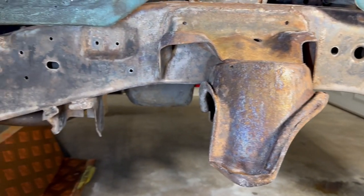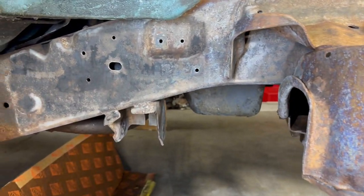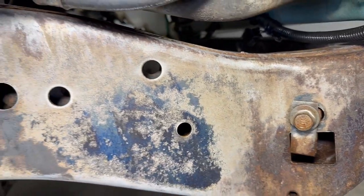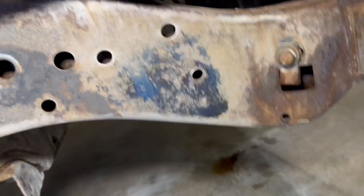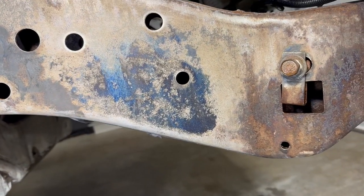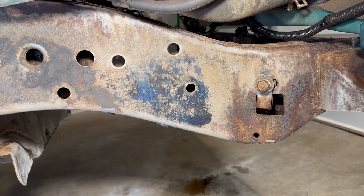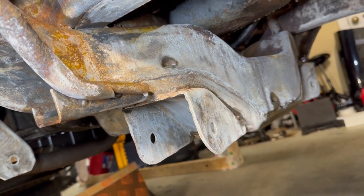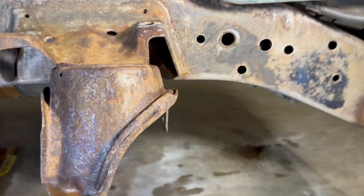Update: it's been about 3 or 4 hours and this section has dried out for the most part. I got a little nervous when it was still wet and hadn't changed color, but after it dried it's got this white powder to it, and on the areas that were really heavily rusted it turned gray. This part over here almost looks like a rainy oil spot — it's got like a rainbow blue color. The area that's almost completely white is exactly what's supposed to happen — it should be really good for painting. Another update will happen in about 2 or 3 days.